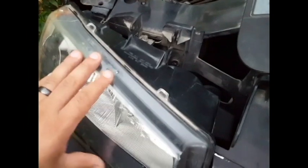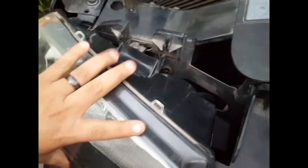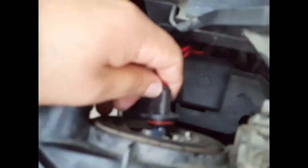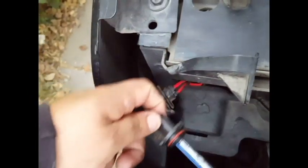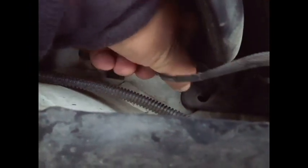Alright guys, I trust you guys that own these kinds of Chevys know how to take off these lights. Just slide that pin out, then you can pop the whole headlight out. I'm going to go ahead and remove the H.I.D. Just leave it hanging. I'm going to unplug this wiring setup, and unplug it from here. This is what I need.